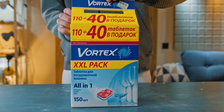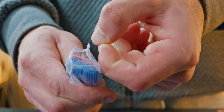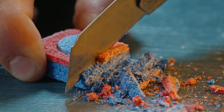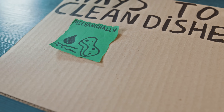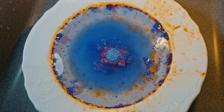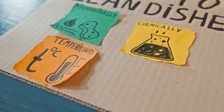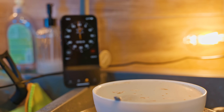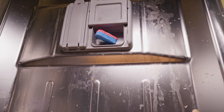At first I assumed maybe the magic lay in the detergent. This pill even looks like a super concentrated piece of chemistry that dissolves everything out. Generally there are four dirt removal methods: mechanical — simply by scrubbing the dirt away with a sponge or using high water pressure; chemical — by using chemistry that disrupts dirt structure at the molecular level and then simply rinse with water; high temperature — hot water also dissolves dirt; and time — just by letting the dishes soak well. Each of these works great on its own, but a dishwasher combines them and they work together to achieve faster and better cleaning.